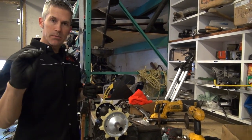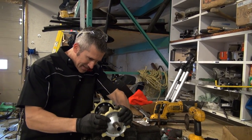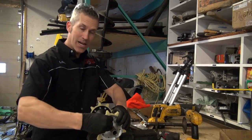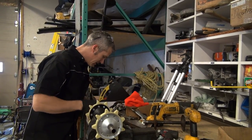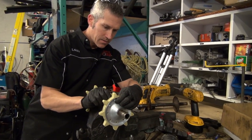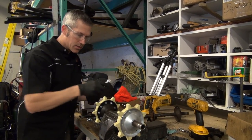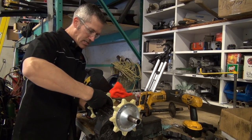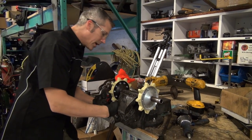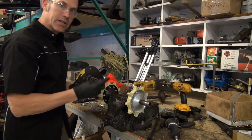All I'm using is a 20 millimeter bolt, and that's it. Put those through, kind of like the bogies, you just got to put a whole bunch in, and it takes a bunch of time to tighten them all up. And there's a lot of them. There's 18 per axle. I'll tighten this one up right now so the bolts, screws don't fall out. I do these ones kitty corner as well. Make sure it goes on straight. Now these ones you can tighten up a lot better.